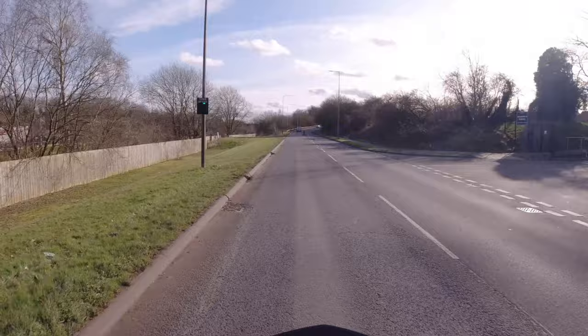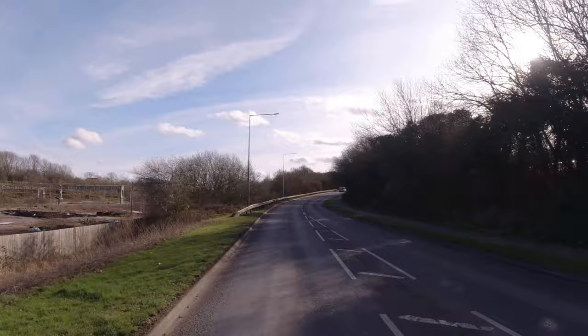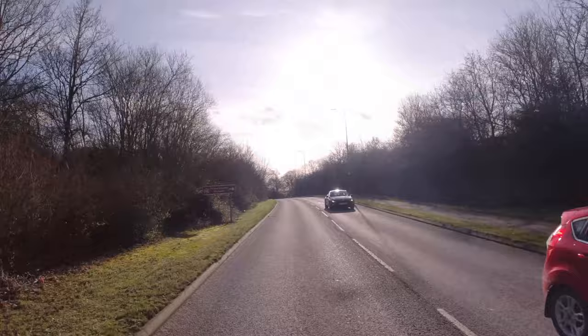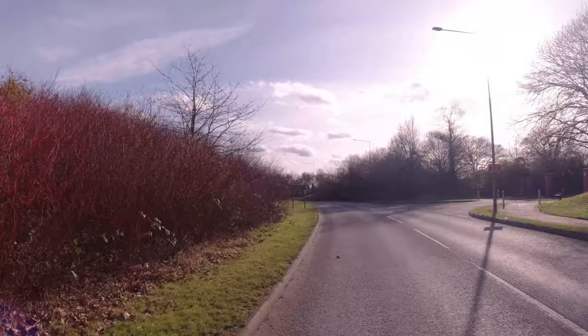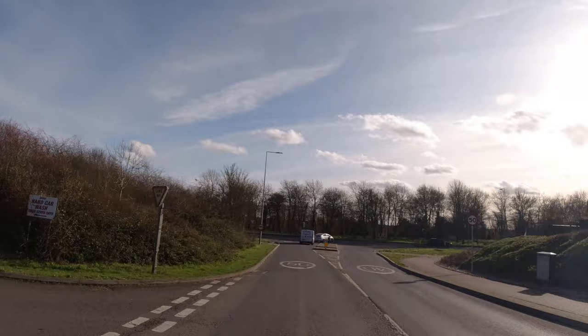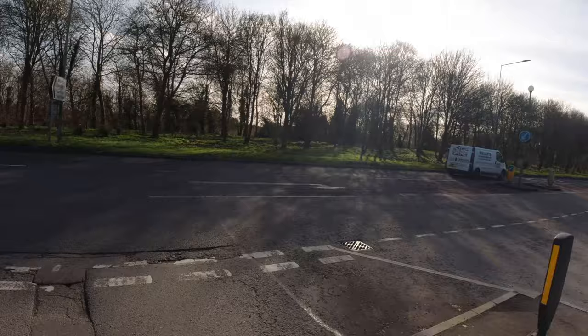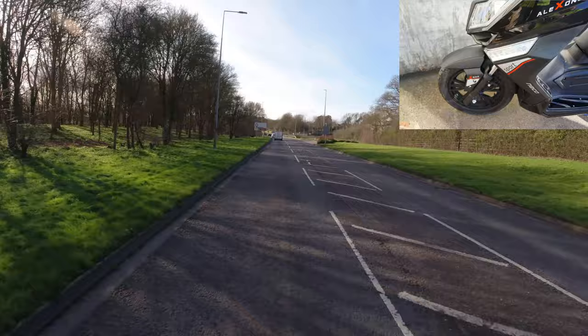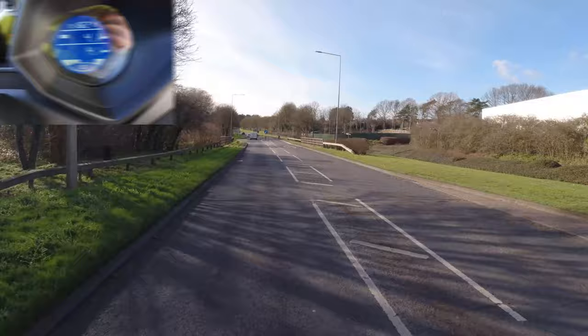There are some nice features on this bike. It is very comfortable to ride and will be good in any sort of weather conditions because the majority of your body is covered by screens and panels. It comes with LED rear lights and really bright front headlights, plus a side light. You can turn off the headlight but not the side light for Euro 4 spec. Being Euro 4 spec also means it has combined braking, so when you pull your back brake, 25% of the pressure goes to the front. It has a digital speedo and a digital rev counter.